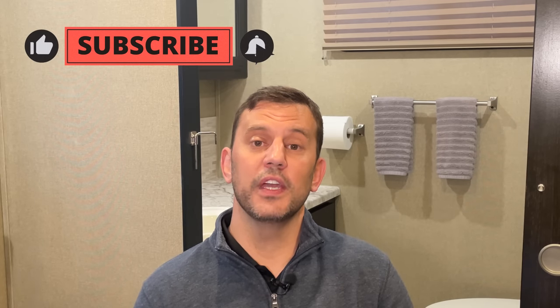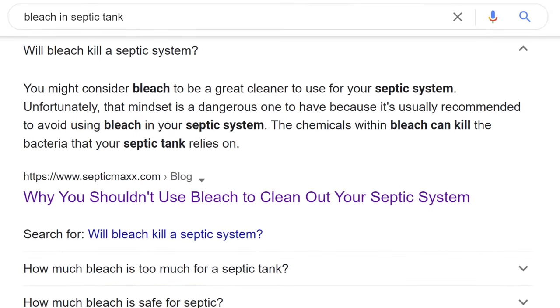In this video, we've talked about a couple of different black tank treatments, and there are a lot of others available. But I do want to mention one thing you should not be putting in your black tank, and that is bleach. Bleach is a great cleaner for a lot of things, but the problem is it will kill the good bacteria in your black tank that eats up and breaks down the solids. No matter what you put in there, don't ever put bleach in your black tank.